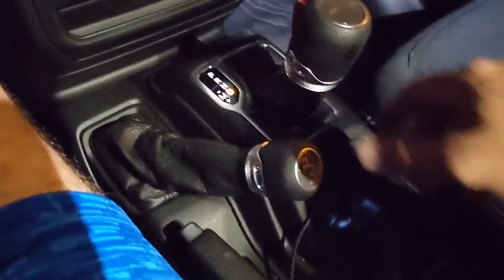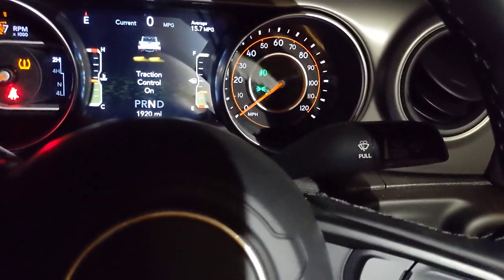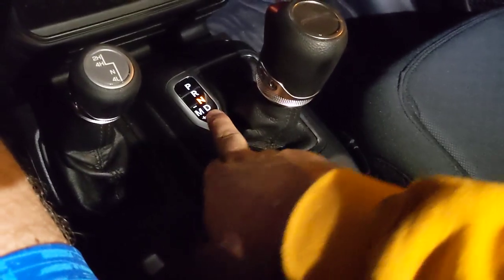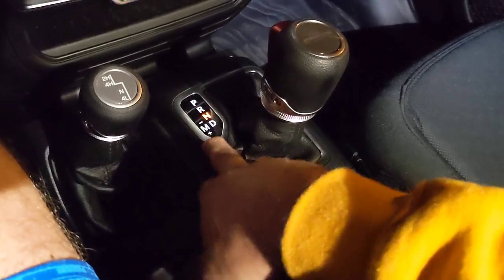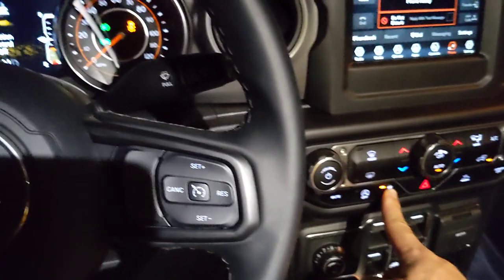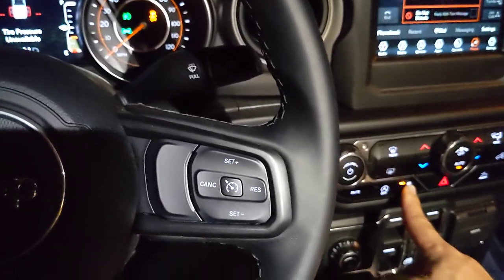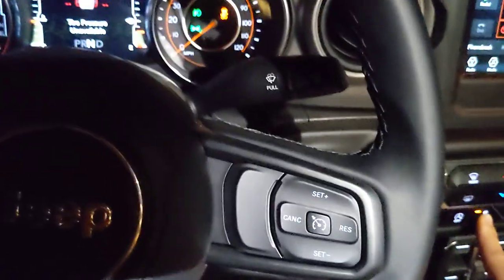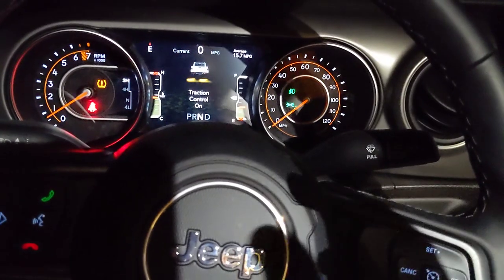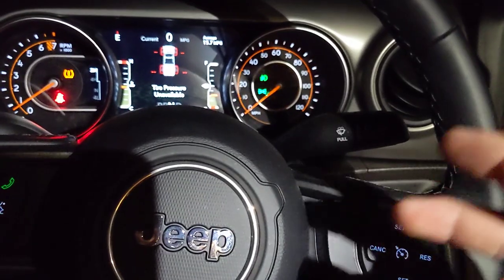If anyone knows how to get this thing into electronic stability control off in two-wheel drive, please let me know. I know you can pull the ABS fuse or something like that on most vehicles to totally disable it. I was thinking about getting a tuner because I was so mad that I could not spin my tires as fast as I wanted in four-wheel low, but putting it in manual mode totally fixes that issue. You can think of the M as mud mode, not really manual mode — in four-wheel low, that's the mud mode. I really wish I could find a way to hold down for five seconds and turn off traction control permanently in two-wheel drive, but this Jeep just doesn't do it. I've held it down for a minute before and eventually it puts it in some weird mode where it turns traction control back on. I've tried double taps, I've tried all kinds of stuff — nothing seems to turn off the stability control in two-wheel drive that I can find. Comment below if you know something I don't.